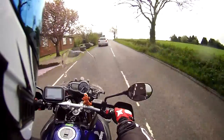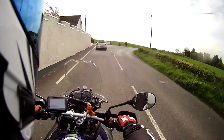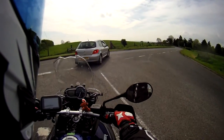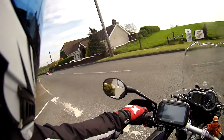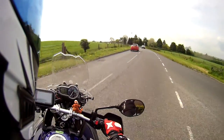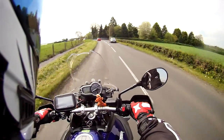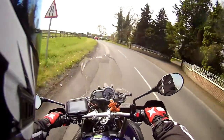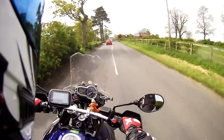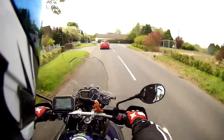I haven't taken it up further than that - I don't want to ruin the comfort of this bike. There is a notable difference in stiffness, but it still retains quite a bit of comfort, and that's what you want with this type of bike. That 15 clicks seems to be the job so far. It stopped it tracking lines in the road, which it was doing, and just gives it a far more positive feel.